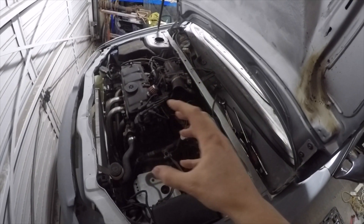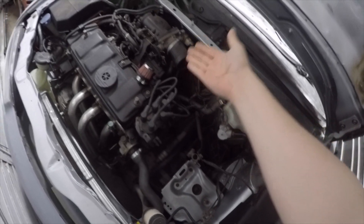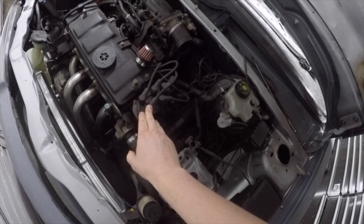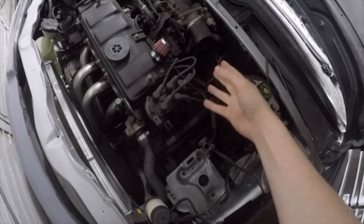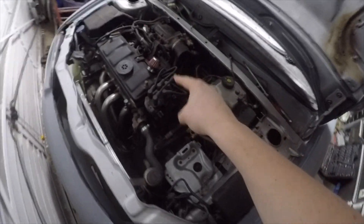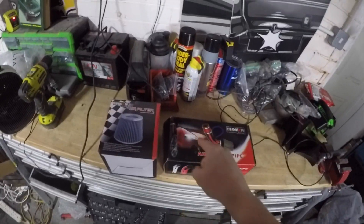So it doesn't quite fit certain things, mainly to do with where the inlet is on this - it's obviously different to a normal 1.6. You kind of can't get something that fits around this, and a normal one litre doesn't have this, which means a pipe could go across here. Loads of stuff that means this isn't going to be as easy as it looks. So what we decided to do was literally just bang on the cheapest eBay universal induction kit we could find, and we will see how universal it actually is.